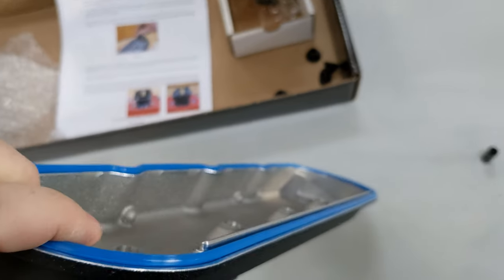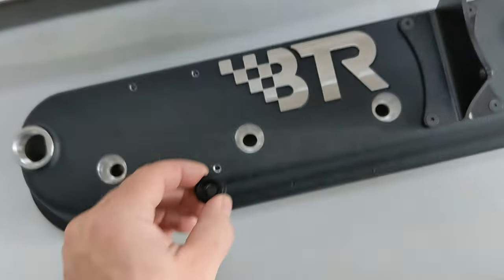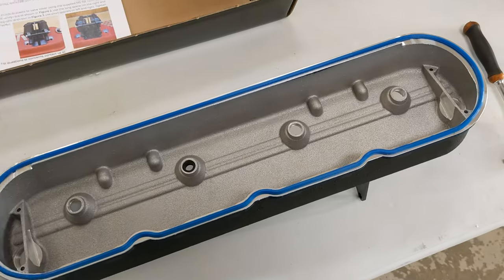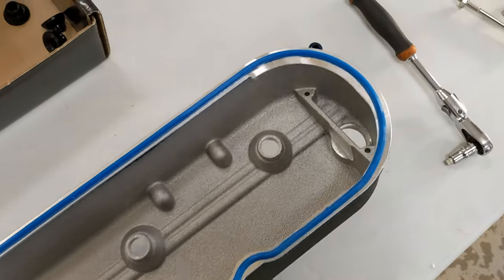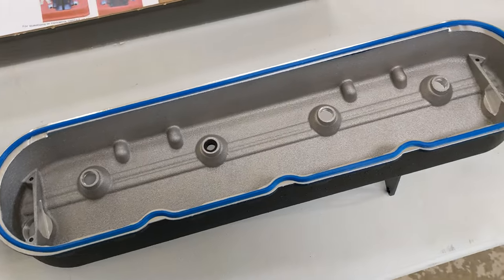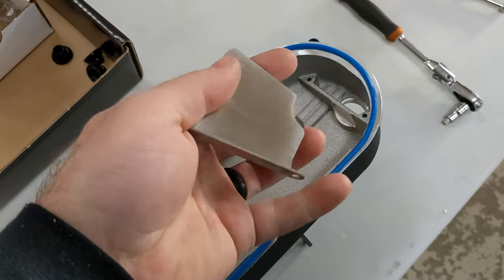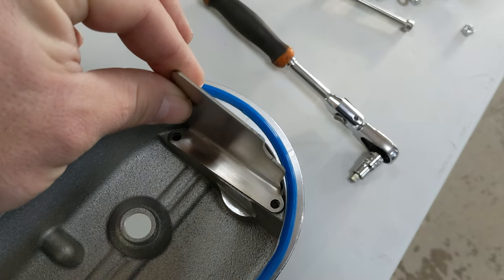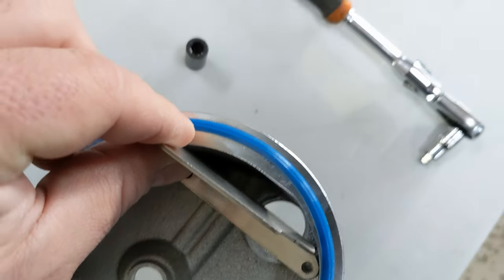The gasket fits perfect and I love these stock gaskets. Every other aftermarket valve cover I've used with an o-ring style has always leaked. It also fits stock - it uses the stock Felpro inserts for the grommets, and those fit really really nice. Inside the valve cover it's got two spots for ports in the front and rear and they're both 12 ORB. Either one can be used for an oil fill or for ventilation. If you decide to use it for ventilation like I'm going to, it recommends you use a baffle, and the baffles look like these - really nice little units. They go so that it cuts off most of the oil slosh going to the ORB, which is really nice.